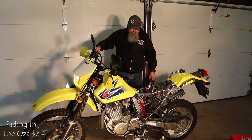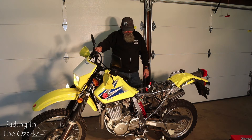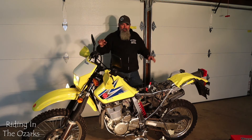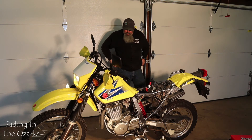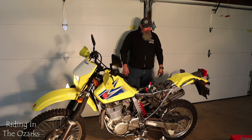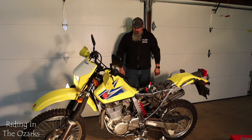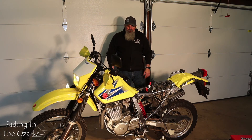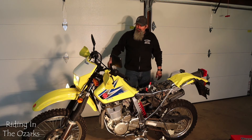Well, she's running — looks like she might need the idle set a little bit. Look mom, no hands, and she's still idling! She seems to be idling a little rough. She may need all the gas ran through, and that may help clean a little bit of crap out of the carb still. It may also be because the airbox is off and the air flow is not quite right, but we got her started.